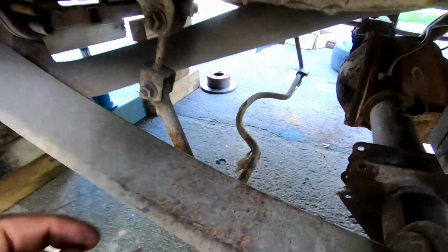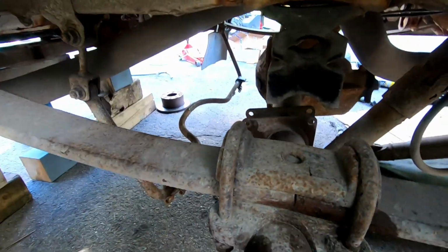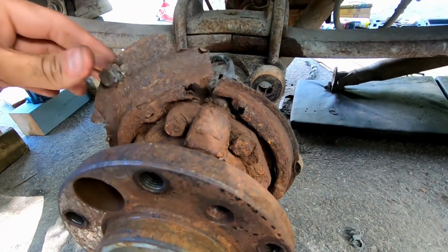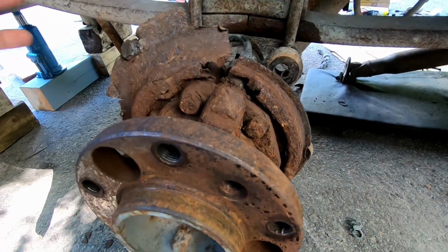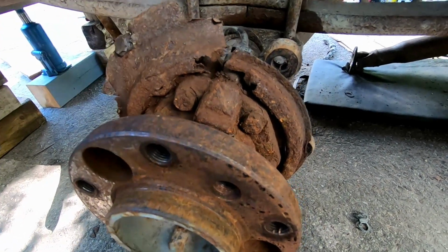After that, sway bar, disconnect it, 2 bolts, one here, one there. You saw me cut the handbrake or the emergency brake cables. We don't use the emergency brake on these. I think we've pretty much deleted them on every single Sprinter we have. Yeah, it won't pass safety, but we don't use it. So this is more of a concern for somebody buying it after. If they want to retrofit the handbrake, by all means, go ahead.